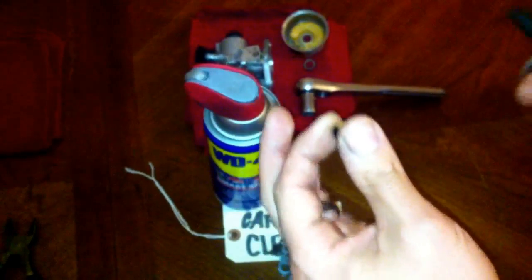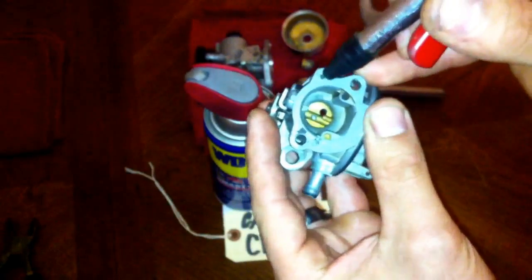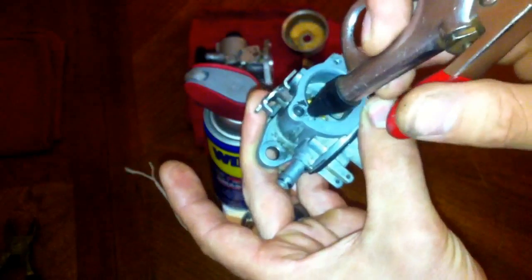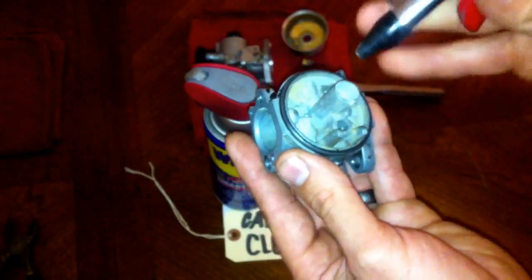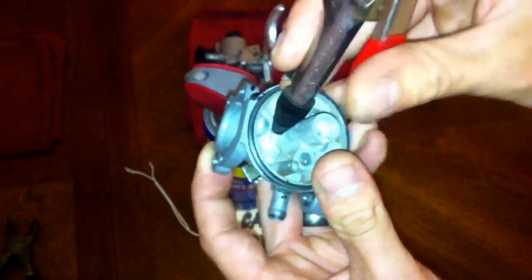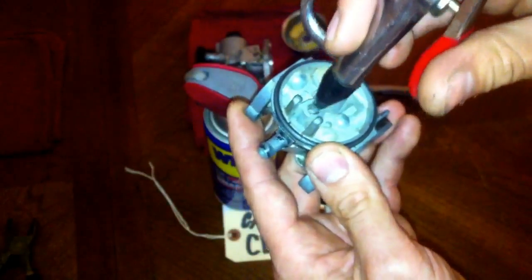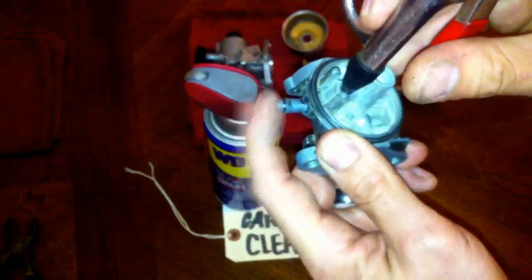Once you're sure those holes are clear, we're going to make triply sure. Take your compressed air can, or even better an air compressor, and go through these holes one last time — through the bolt, the carburetor body, and the priming hole, which is very important. The rubber tip on my compressor seals against the hole so the air shoots through properly. Watch your eyes — wear protective eye gear so you don't shoot carburetor cleaner into them; it burns. We didn't spray carburetor cleaner into where the needle meets the seat, but do shoot compressed air through there to clear it out and make sure everything comes flying out.